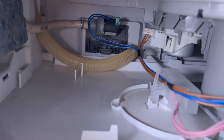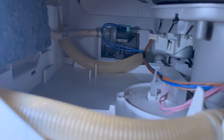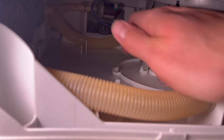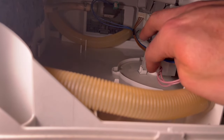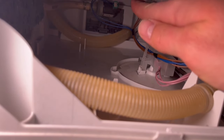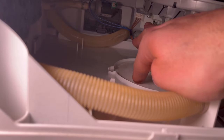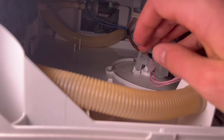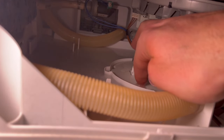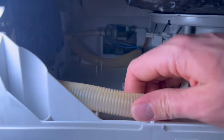As you can see, there is water in the base of the dishwasher, so that safety feature did its job. Now we have to figure out where the water is coming from so we can fix the problem. Just to show you how this safety feature works, you can see there's a styrofoam piece in here and there's water underneath it. There's actually a sensor in here — if this styrofoam piece gets water underneath, it floats up to the top, engages a sensor that detects a potential leak, and shuts everything down so you don't get a flood.